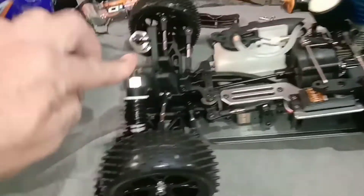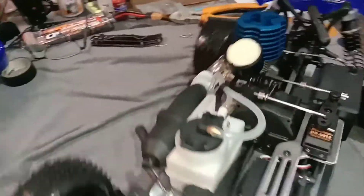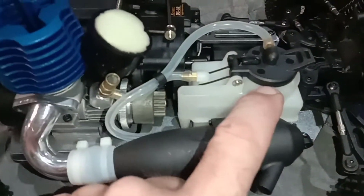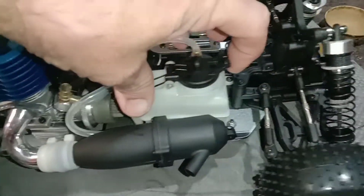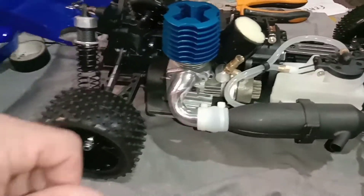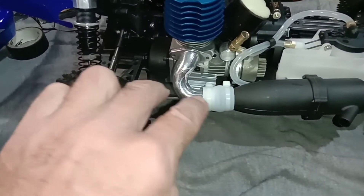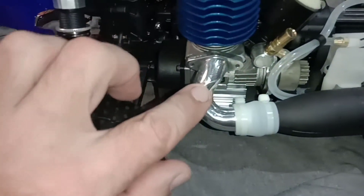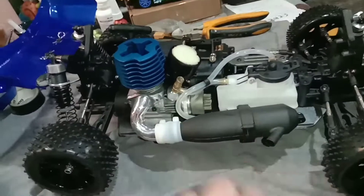The shocks are nice and oil filled, I don't think I have to do anything with that. The gas tank is pretty cool — it's got a catcher here, if you spill some it'll drain out the bottom of the buggy. I have the proper squeeze tube with that bent spout, so I shouldn't spill too much. On the HSP it just has a square exhaust manifold, but here you've actually got a nice header system, a nice pipe, so I would think you get some better flow that way.